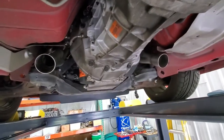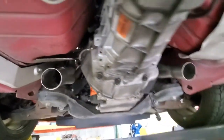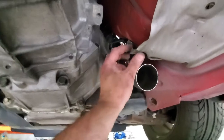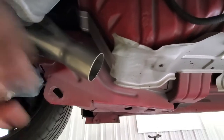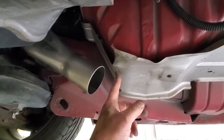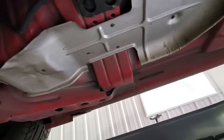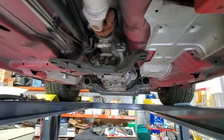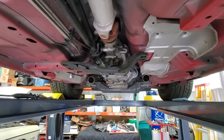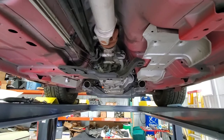This is coming along pretty nicely. We had forgotten to put that up — that's really fun with the header there — but we got it. This was previously bent; I've got it bent most of the way back together, but I think we're going to have to clearance it here, whereas before they had it full because the headers came to a different location. Unfortunately, because the car had headers, we don't have the bracket tree here and I'm certain I have one of those mounts somewhere, because this new exhaust does rely on it.